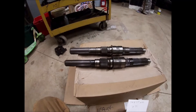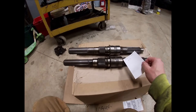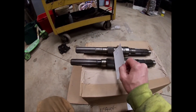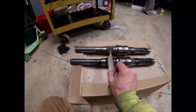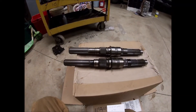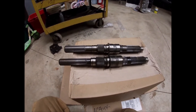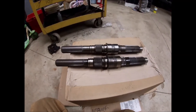I'll give you the spline counts on the shaft that came out of mine: it's 34, 37, 49, and 32. There is another one to watch out for too - there is a 39 spline right here, almost the same diameter. It would be a 39 spline count, much smaller diameter, for a different oil pump. There's a 49 spline oil pump and a 38 or 39 spline version. You can get the same exact shaft in a different oil pump spline, so you've got to be careful in what you're ordering.